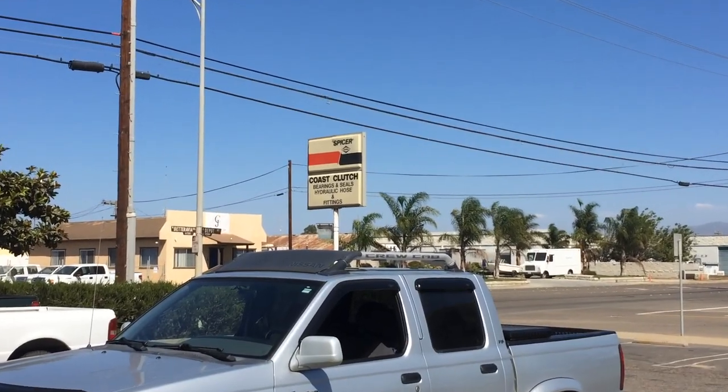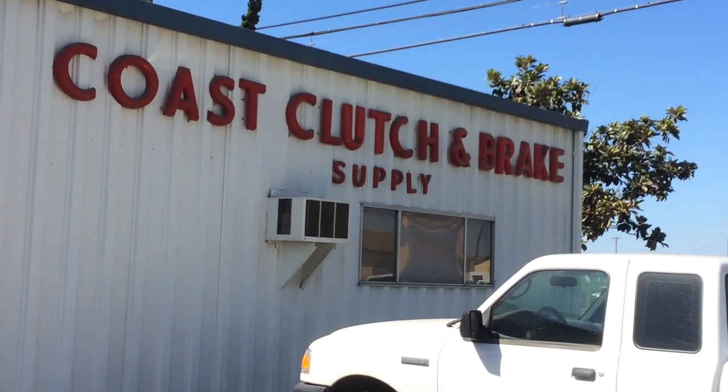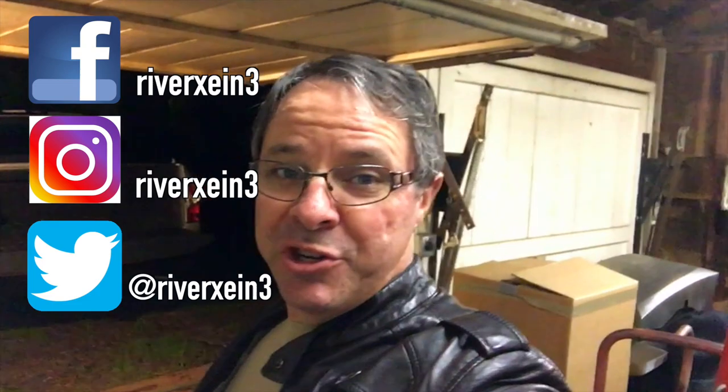Many thanks to Greg at Coast Clutch and Brake in Santa Maria. Took my line in the back, zip bang. 8 minutes later, I had a new brake line for $9. Thanks again, man. I wanted to show you the line that Coast Clutch and Brake made for me, but we've moved a few times and everything's in a box. So I blew through like 20 boxes and can't find it. So it'll have to be part of another episode. But essentially what happened is Coast Clutch and Brake took my old line because, of course, they don't have metric fittings, right? So they got to use the fittings off my old line. They cut it in half, used my fittings, made a new line that's like 2 or 3 centimeters longer. So we'll put that on the car later on.